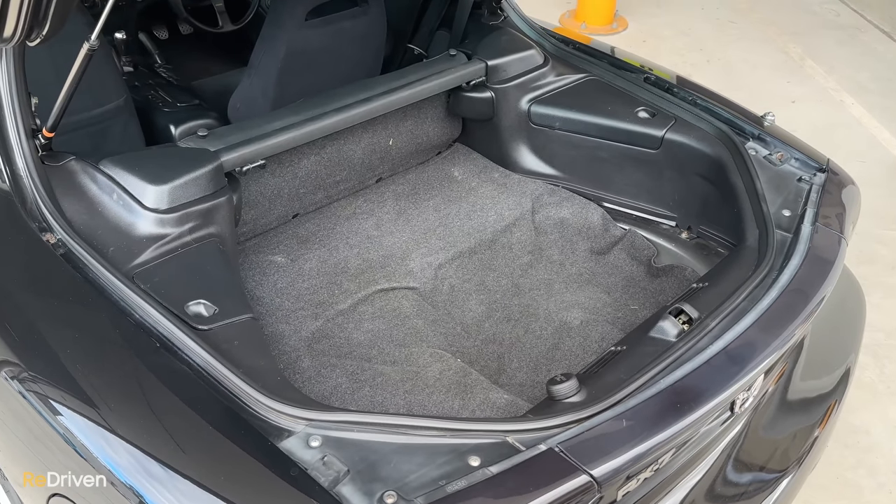Let's kick off with the exterior. The paint — if it's uncared for, left out in the sun and hasn't been cleaned and polished regularly, the paint especially on pre-1994 models can fade and even crack and peel. If the RX7 you're looking at has been fitted with a body kit, make sure it's a quality body kit fitted correctly — cheap dodgy body kits that are screwed and glued on can let moisture and water get in behind the panels and things go horribly wrong. Some early models can suffer from a ripple effect on the front bar from the hot Aussie climate. The bonnet latch and hinges can get a bit squeaky — not a major problem, but some people mistake it for a suspension issue.